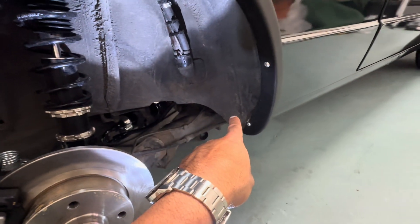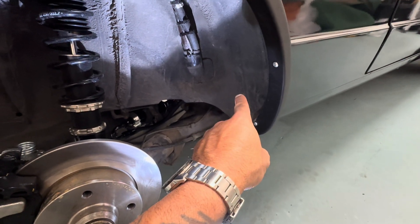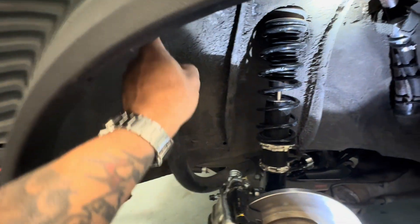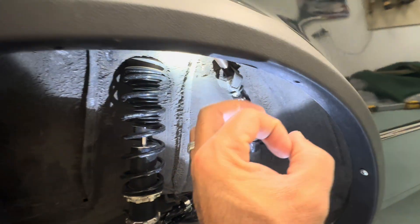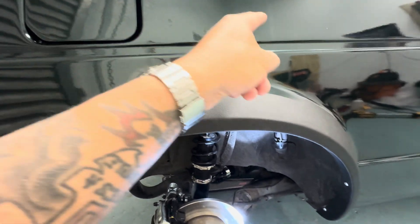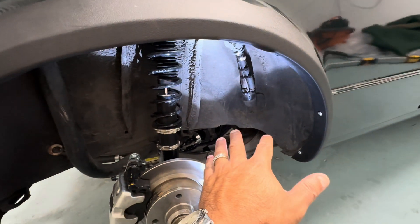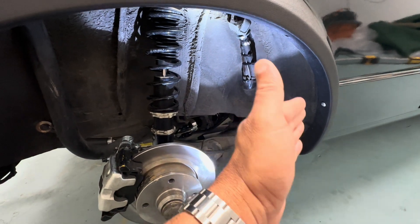I think I found the issue — it was because of how the fuel tank was installed, not by me but by someone else. There's a vent that goes from the fill tube and it goes across the top of the gas tank. There's a clamp that needs to go on top of there and that clamp was never installed. So when I would get gas and it overfilled, it went through the overfill vents and just spilled out, so the gas tank wasn't making any pressure.